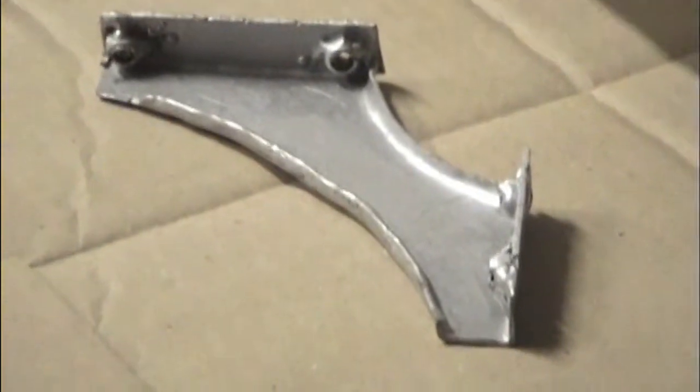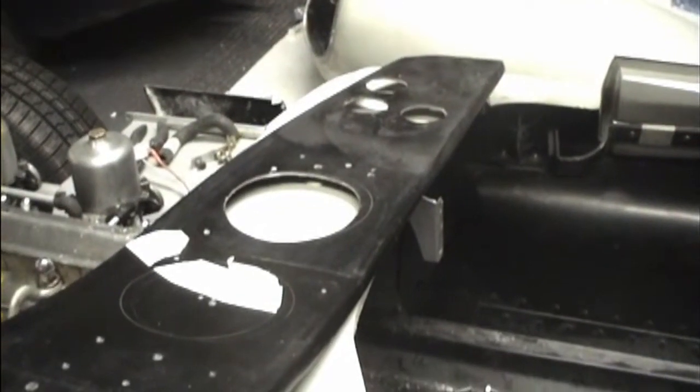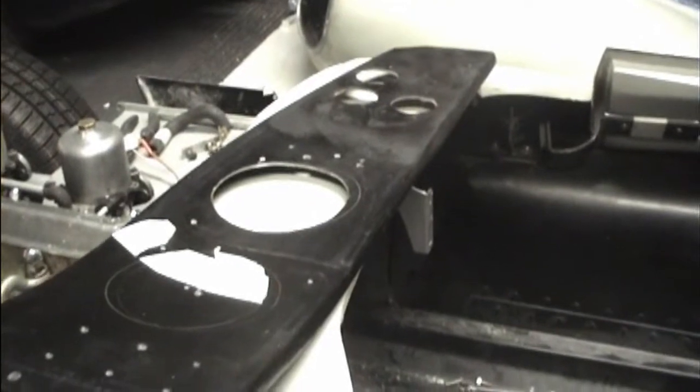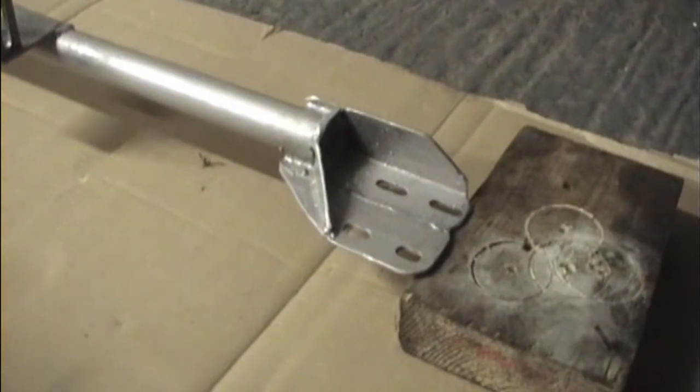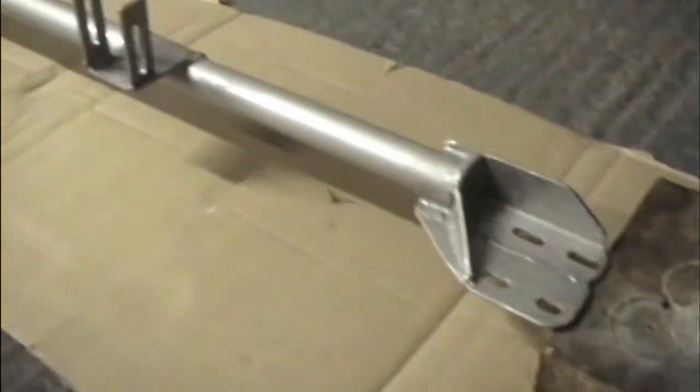Dashboard mounting bracket shown with the welding nuts. I ran into trouble when I cut the holes in the dashboard, and the instruments fouled the cross beam that used to run across there. But this was the modification to move the crossbar towards the front of the car, hence 2 lots of slotted holes. Well, I'm now going to take the dashboard off so I can take it inside and see if I can fit the harness to the back of the dashboard.